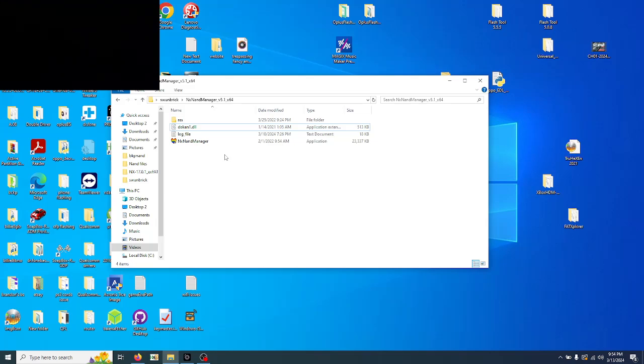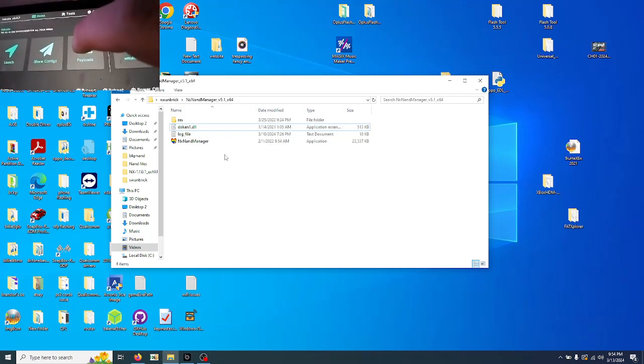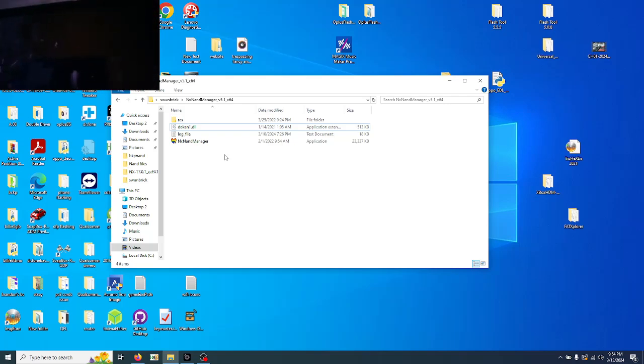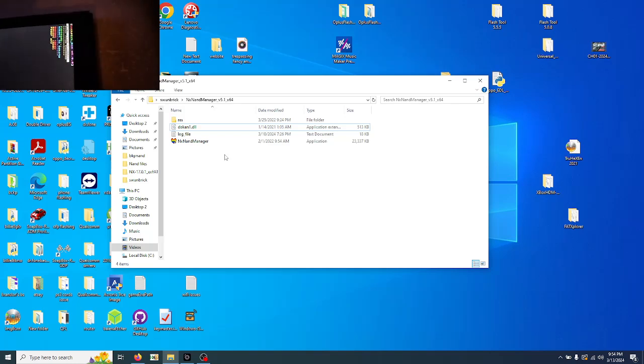What we're going to do is program the Samsung NAND over to the current setup. First off, we're going to go lockpick RCM. Get the product keys. Dump from sysnand.